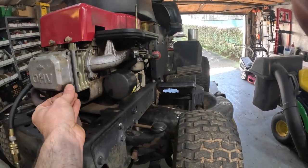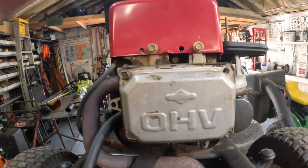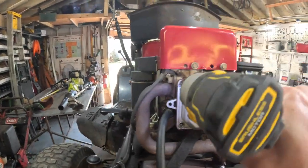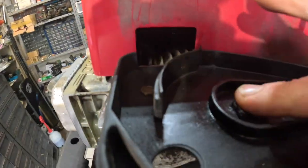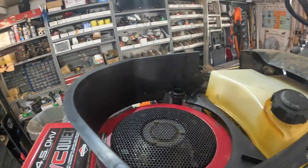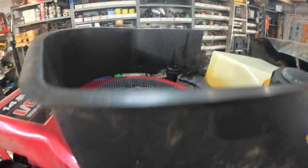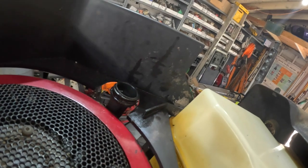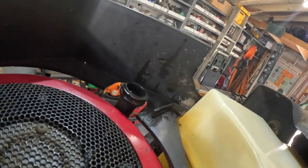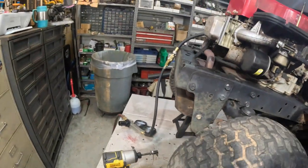Yeah, you can hear the air escaping. Usually I'd have this done by now, but I'm filming it and I want to show you guys. Now, I'll take this off. And I am going to put my finger over that, and I want you to watch the dipstick tube right there. Yeah, look at it smoking coming out right there. So, I believe we got a blown head gasket.